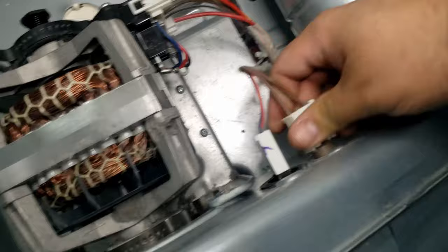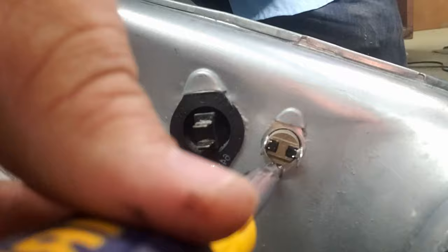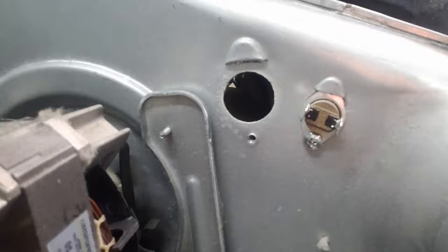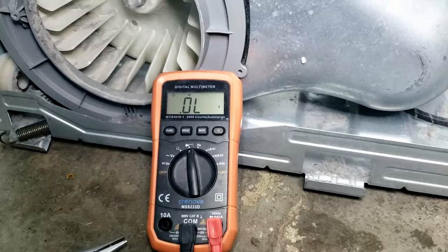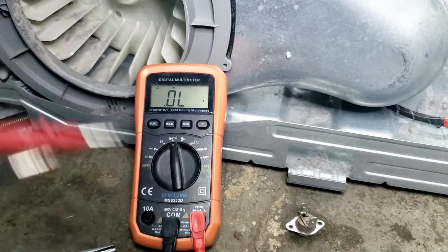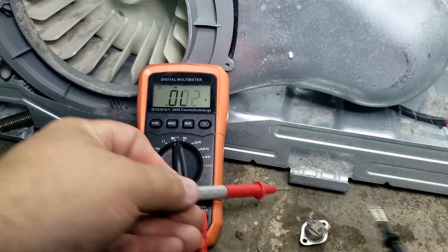The thermistor and thermal fuse are located directly behind the blower housing and beside the motor and idler pulley. The thermistor helps the dryer know what temperature the blower is set at, while the fuse will blow in case it ever overheats, shutting the entire dryer down. Both are pretty easy to take out — on this unit, each is held on by only one screw. The thermal fuse uses a simple continuity test: any resistance value shows the unit is good. If it's bad, there won't be a value and you'll get an open line on your multimeter.